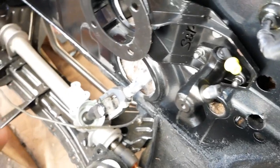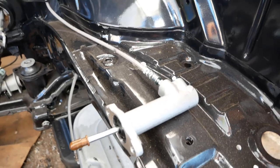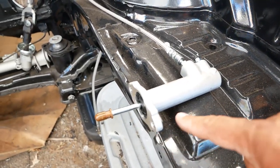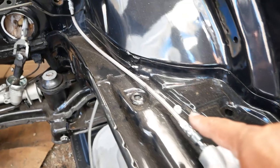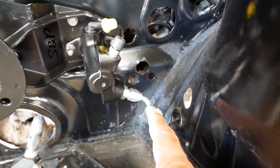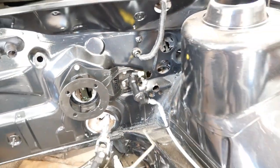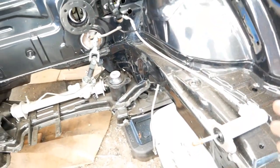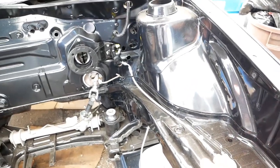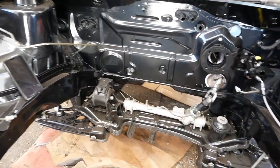There's a steel braided hose that goes in here and then you route it out. Here's the slave cylinder, the clutch slave, and the steel line — follow it over. There's a 90-degree fitting that SMP provides that goes into the master. That is pretty much how you're going to route your hydraulic system for the O2J transmission that we're going to be mounting here with the 1.8T engine.